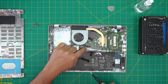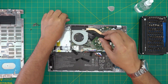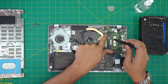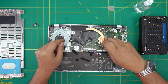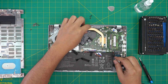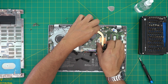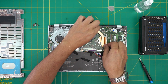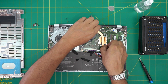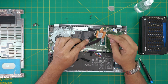Remove the tape over the fan connector. To properly remove the fan connector, don't pull on the cable. Remove the two screws for the fan and put it to one side. Then remove the three screws for the heat sink. When lifting the heat sink, don't lift it from the far end — lift it close to the heat sink, grab it from the corner, and wiggle it around to break the old thermal paste seal.